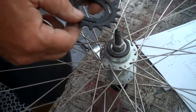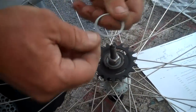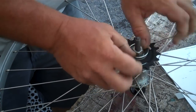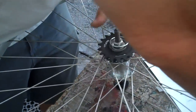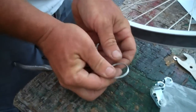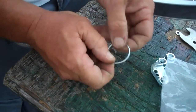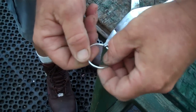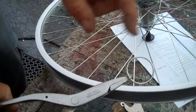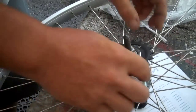Now onto the cog. You got a little dust cover ring thing — that goes on first, straight on. Then comes your cog. This is an 18-tooth cog, kind of the normal. Going to fit right onto there like that. Then we have this lock ring. You guys might not have reverse pliers, but I have reverse pliers. You can just force it on there however it takes. Me being a paid professional, I have what they call reverse pliers. I've now set my reverse pliers inside of that little ring thing, getting it onto here. Give it a little push out. Bada boom. How smooth was that?